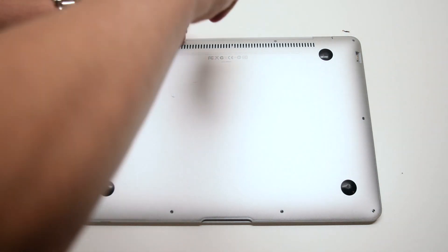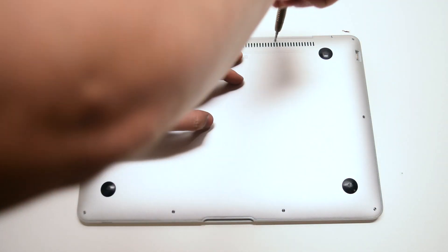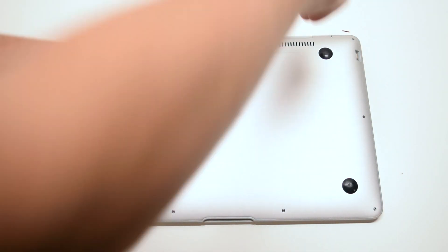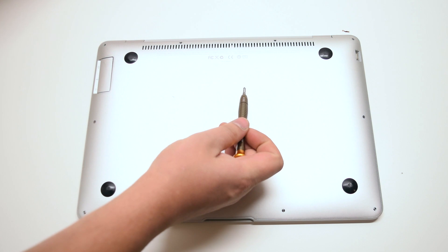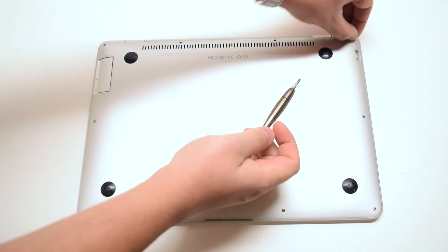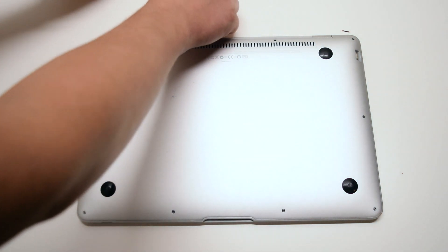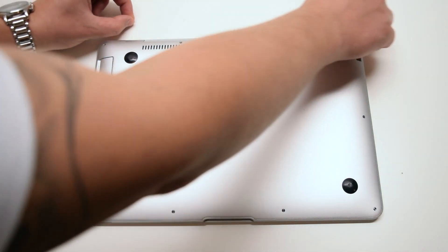In the middle, the two top screws are the longer ones. So in total there are two long screws in the middle top, two medium length screws on each of the top corners, and six very small screws going around the rest of the contour of the MacBook.